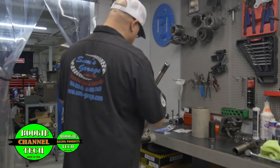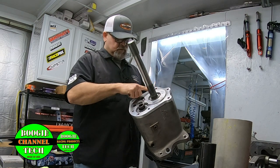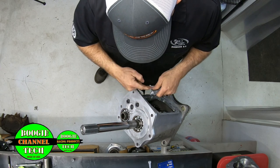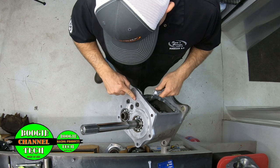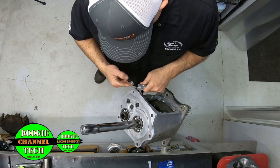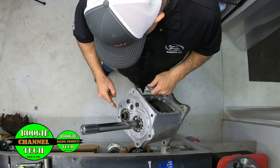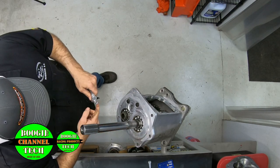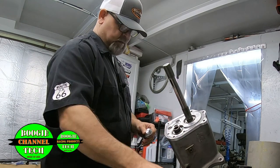Now we're going to put the tail housing on. So I do it again, just go on around. Like this right here. I just come around where I know I need it. I don't go crazy putting it everywhere. I mean, I put it around there, but you don't have to. Some people glob way too much silicone and sealer on the stuff. That's just a waste, dude. I come right around through here like this, and that is done.